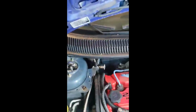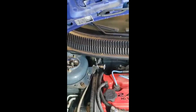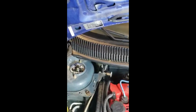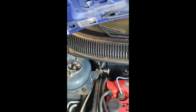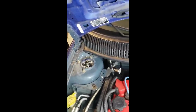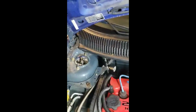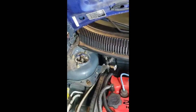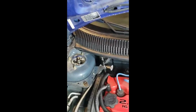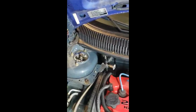One more thing, guys. Whenever you finish the fuel system, you want to adjust your regulator. So either you can ask your tuner what pressure they recommend, or you can go by what the injectors recommend. Most of the injectors will say 43-44 psi. Now you're gonna set it at 43 without connecting any vacuum line to it, because if you are connected on anything after the throttle body, you're gonna have vacuum, so the gauge is gonna read lower. If you connected to the turbo or to the cold side pipe, you should be fine, because that's only pressure.